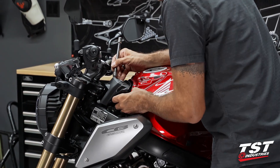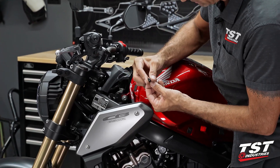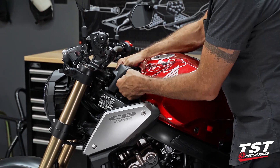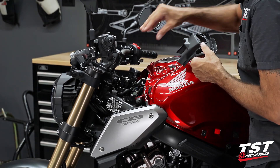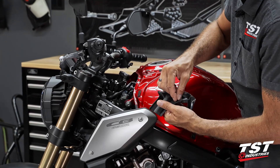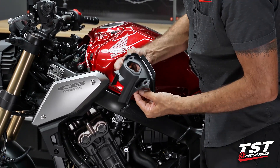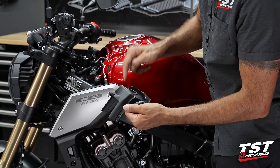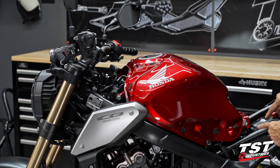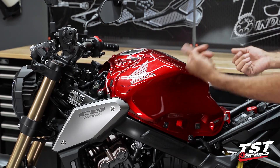The ignition shroud has two push-type fasteners. Reset them by pressing in the center — when you press the center in, they become unlocked and you pull them out. This gets pulled up along the same axis as the ignition barrel and it comes off. When they're on the bike, they're forward of these rubber grommets. Now we have access to this 10mm fastener — same one on the opposite side. There's a 10mm fastener going through the tank, and it'll be necessary to lift the tank. I'll undo these fasteners and we'll get into the hoses in just a little bit.